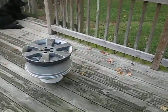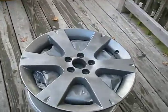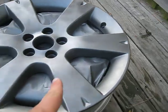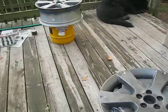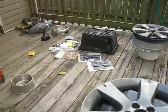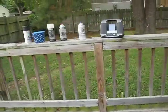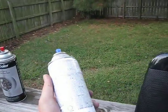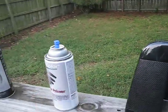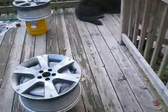Okay? Then, after you sand them down, scratch everything you see. Anything that I have paint on, you're going to scratch it. Scratch under here, and just scratch it with 320. Just get 320, that's it. Now, you need 600 grit sandpaper when you use the sandable primer. Nothing more than 600. It even tells you on the back, 600. Prime it, 2 coats of primer, sand where you need to sand.